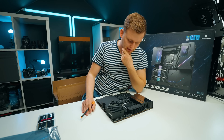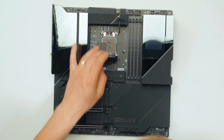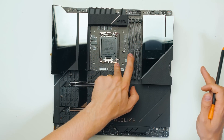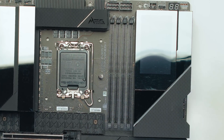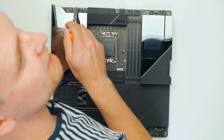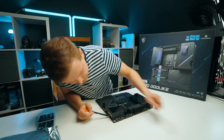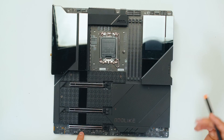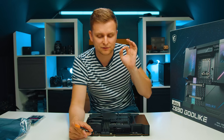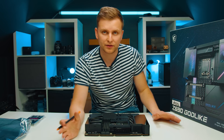Let's start to look at some of the motherboard headers. Obviously this is a Z690 motherboard, which means this is the LGA 1700 socket for 12th gen Intel and hopefully 13th gen as well. On this side we have four DDR5 DIMM slots — if it's a high-end board, it's obviously DDR5, not DDR4. Then on the top there are system fan and CPU fan headers altogether — quite a few. 10 fan headers total, and the pump fan header is rated higher at 36 watts, so it's 3 amperes, while all the others are the usual 2 amperes.